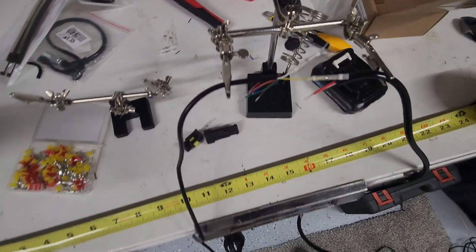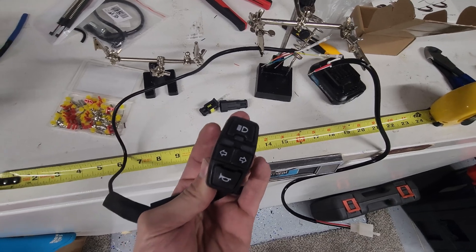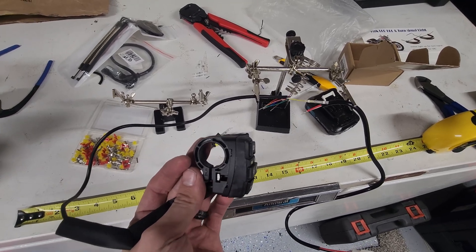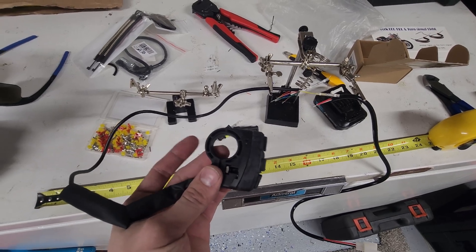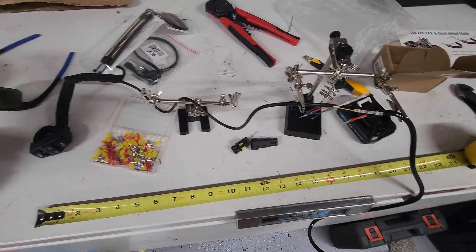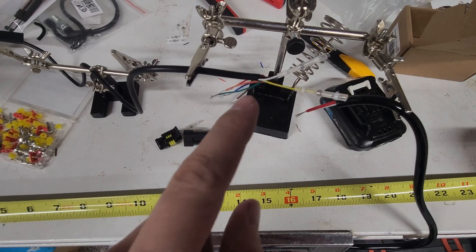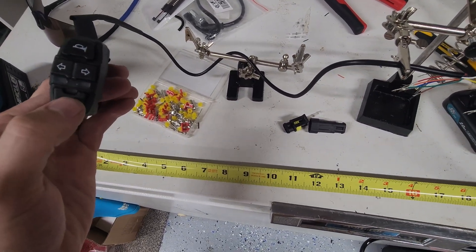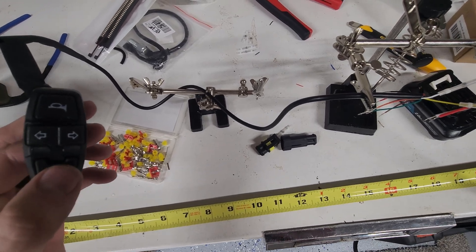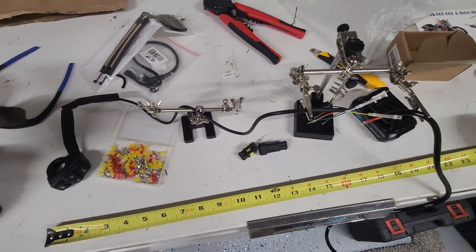Now I'm working on wiring up the bar switch right here. This is the same bar switch I use on pretty much everything — it's just the cleanest, best looking, most waterproof. It's just an awesome switch. I've put a whole bunch of these on bikes. But make sure that your bars will fit through here, because it is kind of a tight fit as is. Right now I'm hooking up the switch for the relay. When I press this, the headlights and the entire kit will turn on. This is basically just the power button, and then on the headlight I have a separate switch for high beams, just because it's cleaner that way.